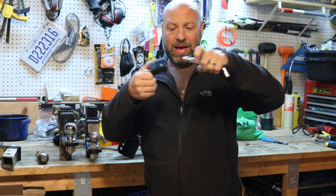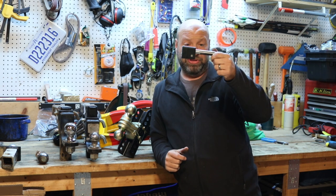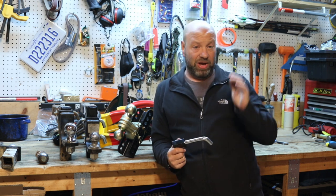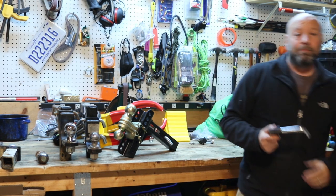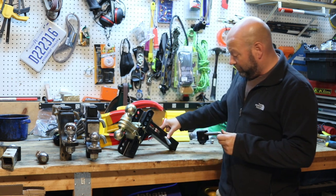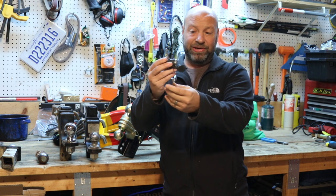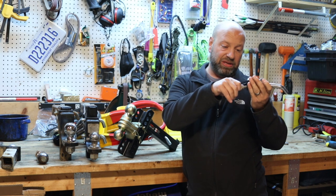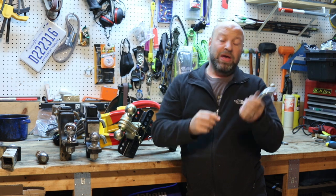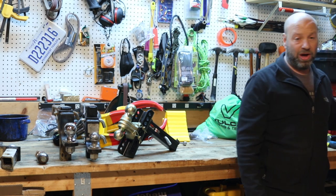Here's a locking pin — it goes through the receiver and locks it to your truck with a key lock. Yes, nobody's going to be able to steal it. But nobody's also going to be able to take it off again until you figure out how to cut it. This is not hard to cut with a chop saw or angle grinder, which is how I have to take them off every single time. On most cars, getting in to cut the hitch pin can be a nightmare. I don't care who makes them — these locking pins will fail after one year. The lock is going to seize and have to be cut off. I've tried every one on the market and had to cut every single one off my vehicle. I'm not a fan.